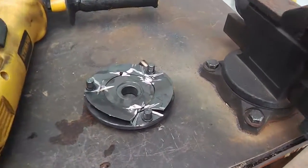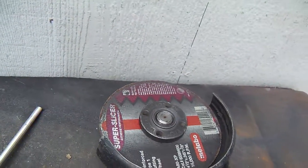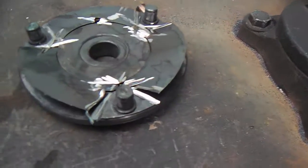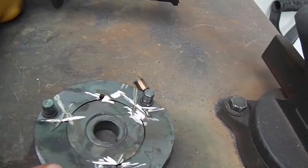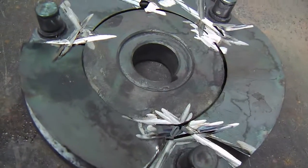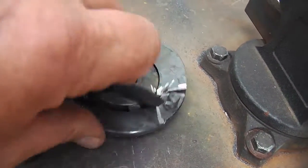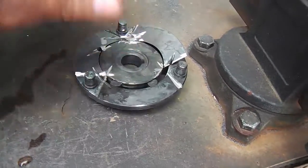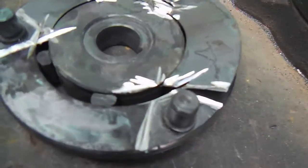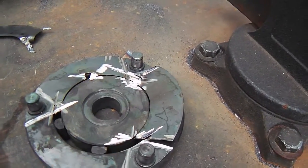And as you can see, with some little grinding action there with a cutting wheel, not the grinding wheel, but one that's designed to give a more slender cut, you just put a crisscross right under a V cut, and that veneer just pops right off, or will pop right off, yeah. And then I can get under there and weld these little tabs too.